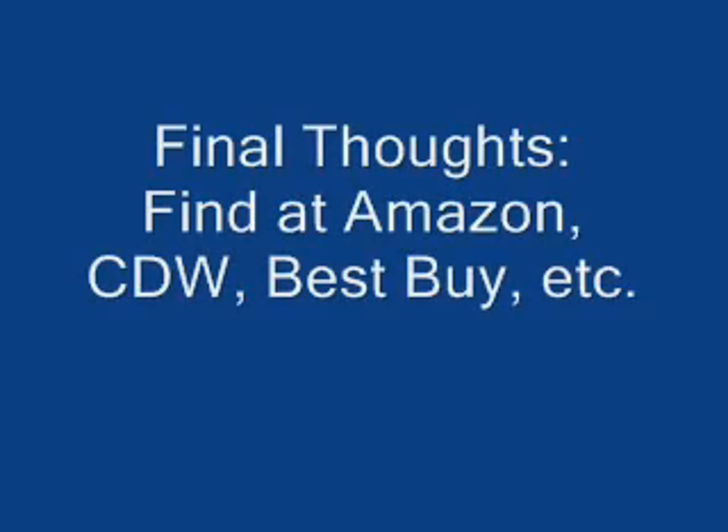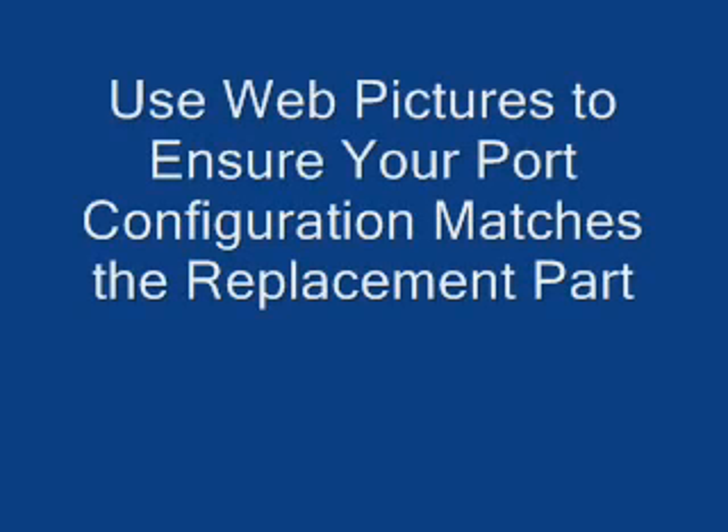One thing I neglected to mention during the video is where to find these parts. Amazon.com, for example, has these listed if you do a search under internal hard drive. To get more specific, you may want to type in SATA 2.5, or just 2.5 — it should get you to the section of their website that has these parts available. The particular things you want to pay attention to: it is a 2.5-inch drive, and the product dimensions so it fits in your hard drive bay are 3.9 inches long, 0.4 inches thick, and 2.8 inches wide. A lot of these sites have them listed with small variations of maybe a tenth of an inch, but that's basically it. Alright, good luck everybody. Thanks for listening.